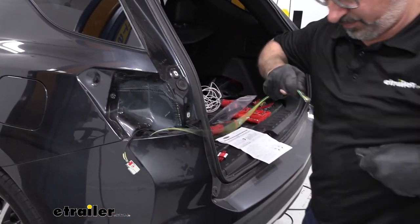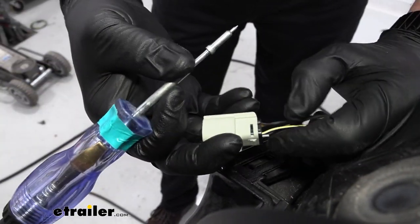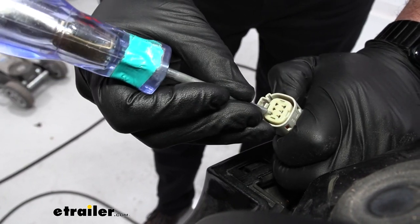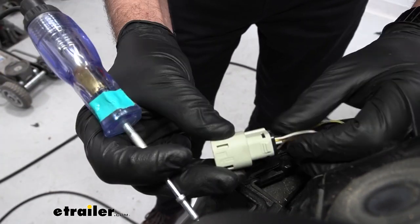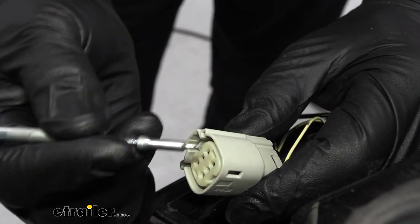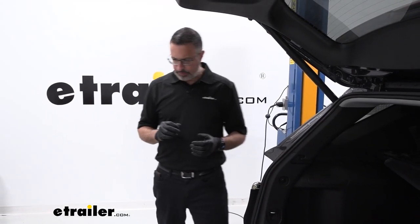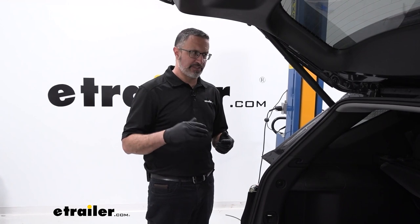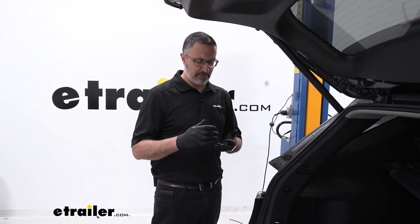We can just fish the wire up from the bottom. Now we need to pin out and figure out which wire is going to be the tail light circuit. I have a test light, I have the running lights on on the car, and we can just go through. That's the only one that lit up and that is going to be the white wire with yellow tracer. This is the wire we're going to be tapping into for the car input for the smart diodes. In the instructions, it will tell you to use the brake circuit for the car input — but we found on our Chevy Equinox and some other vehicles with variable voltage tail lights, once they were hooked up we were having interference issues and the lights were not operating as intended.